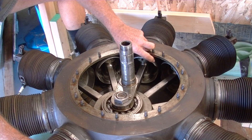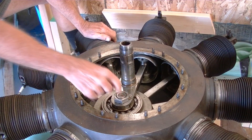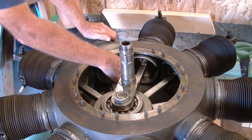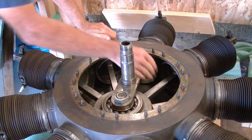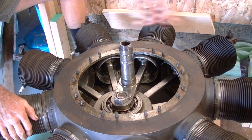So we thought, we'll turn this one around. But when you think of the engineering principle, on a crank the thrust side should be the full skirt, and the cutout side is the opposite side. So in fact, one is correct and one is wrong.